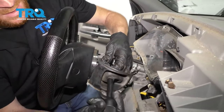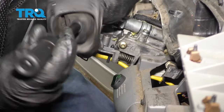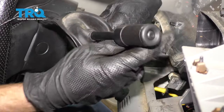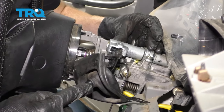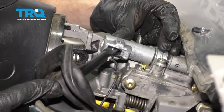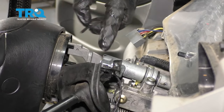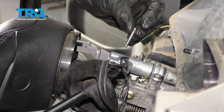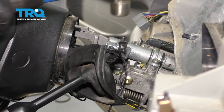Okay, let's get ready to get this into the steering column now. Obviously you wanna have the wiring facing towards you — because if you put it in backwards, well, it's gonna be really funny looking. Just go ahead and slide it right into where it belongs. Now it's gonna be time to put our pin in there. Look down in here — you wanna make sure that you have your holes lined up. After you have them lined up, go ahead and slide in your pin and then drive it down.